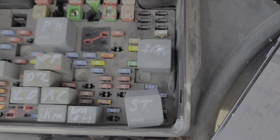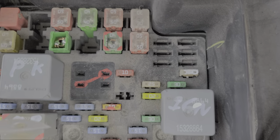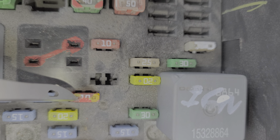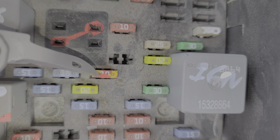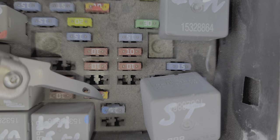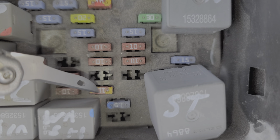What's cool about these fuses is they have exposed metal on them, and you can use that exposed metal to check to see if your ignition switch is working. For the ignition E fuse, the exposed metal should be receiving power whenever the key is in the on position or in the start position. And the crank fuse should be getting power when you are attempting to start the car.